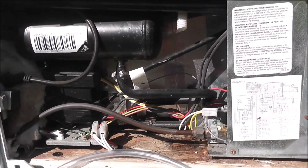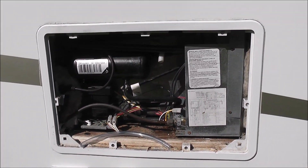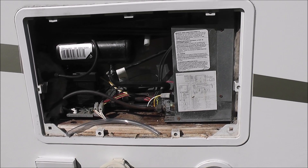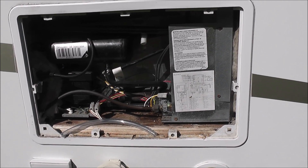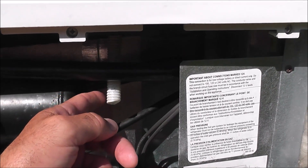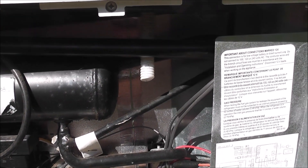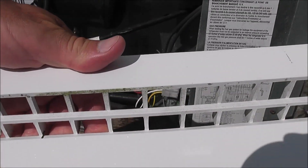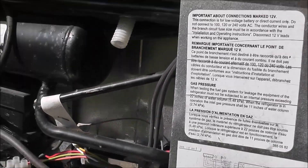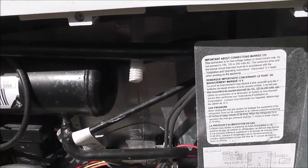We're at the back of the trailer now. This is the panel behind my trailer where the fridge condenser and all the electrical stuff is. You're going to find this little white hose that I showed you — that little small spout — connected to this white plastic hose. Over time, because this is vented to the outside of your trailer and fits through these little cracks, the sun gets at it and bakes it. They use this cheap plastic hose and it will crumble in your hands when you touch it.